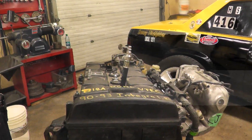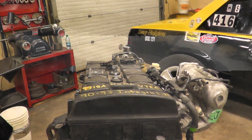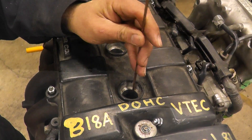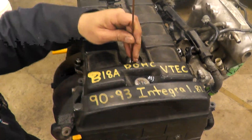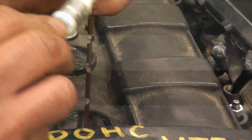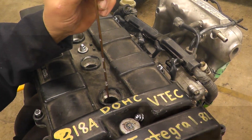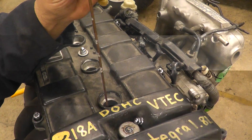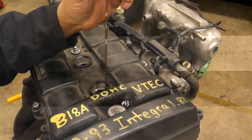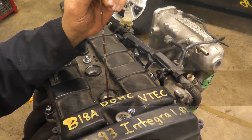At this point we take our balloon off. Now we need to bring the piston right to top dead center. We take the gauge out and put that rod — it could be any rod, I'm just using a welding rod — put that in the spark plug hole. Now spin it again and go up. You'll see the rod coming up. We're going to go right to top dead center, basically to the point where the piston starts going down. That's top dead center, and this is where we're going to test.